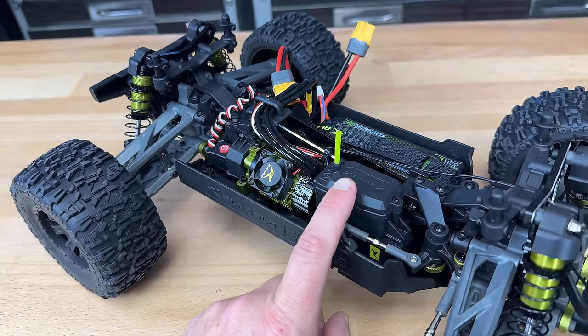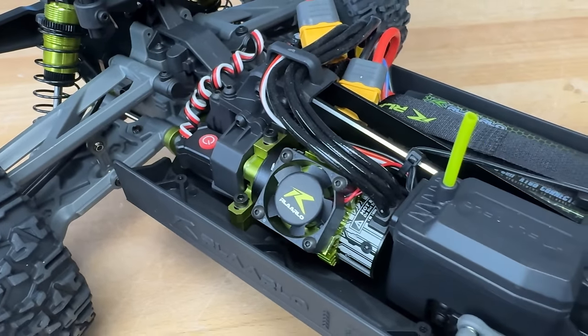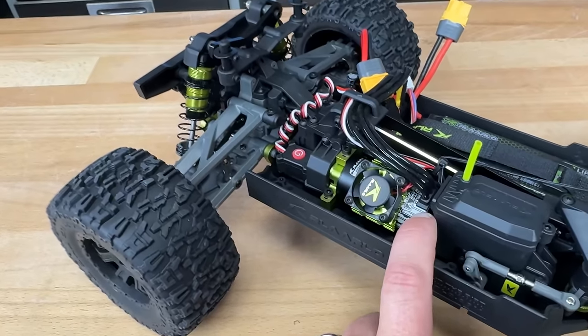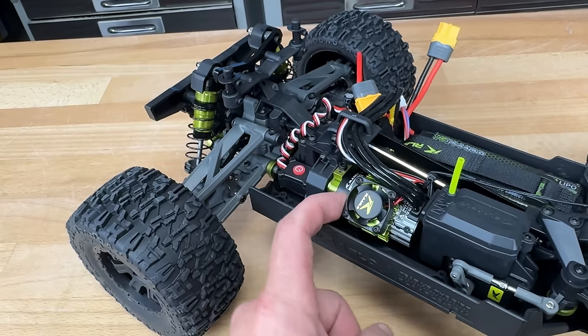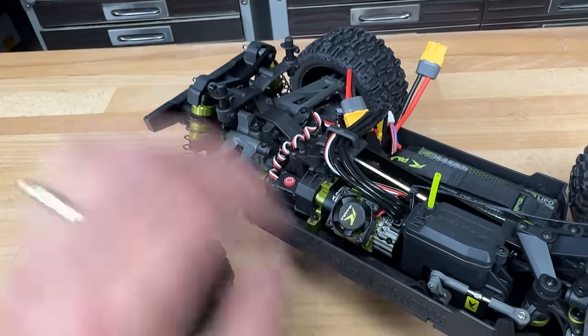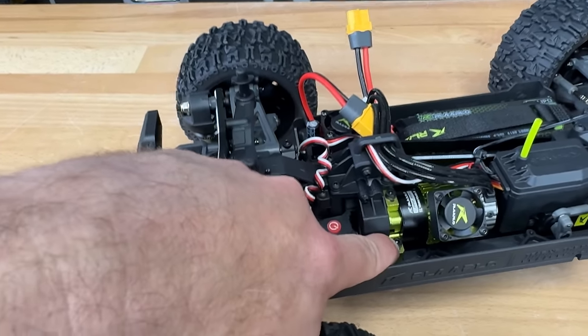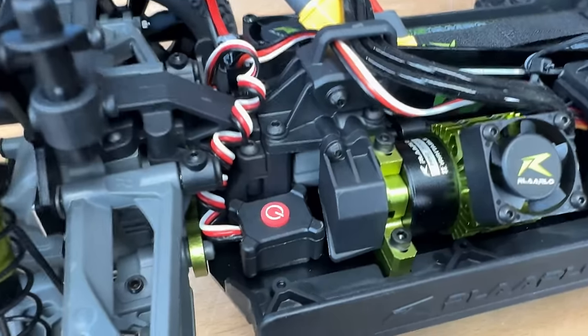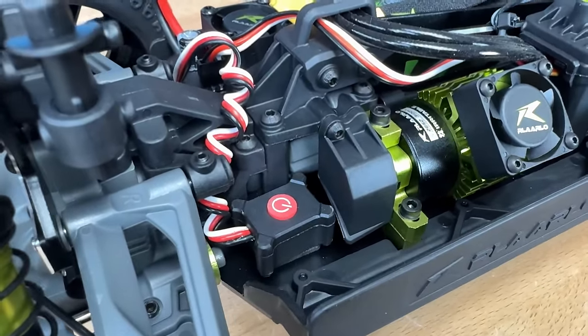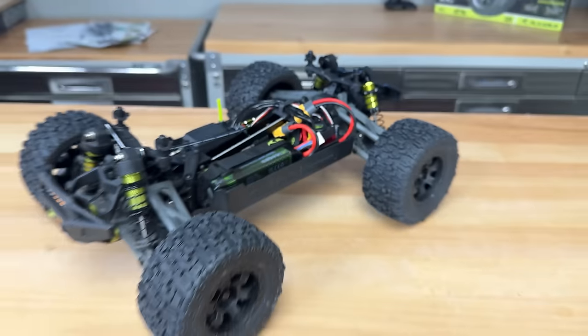The radio box up top has the receiver on the inside. It's got a brushless motor system — sensorless, a 3100 kV motor, with a cooling fan on top attached to a cooling heat sink, so they're taking care of any heating issues. The motor is attached to a sliding motor mount, which I like — that's really easy to adjust when you're swapping out pinion gears. And here's the Rolarlo speed controller we've seen before: 2S to 3S capable, fitted with a cooling fan.